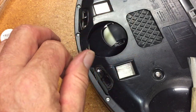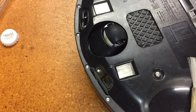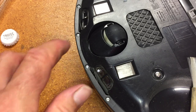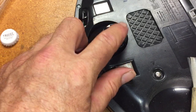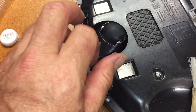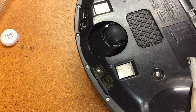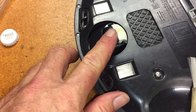Anyway, I suspect that the Roomba was getting confused because if you look in the manual, error 10 can also come when the Roomba is in a wide open space where it's just driving and driving and driving. So I kind of wonder if it was getting mixed signals from this — not accurate signals because of all that dust in there — and that error 10 was not having to do with the side wheels, but just that other aspect of error 10 which says 'I don't really know where I am.'